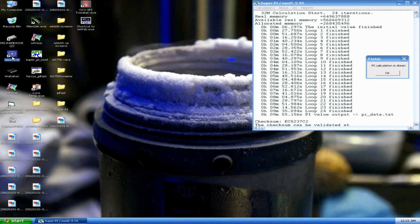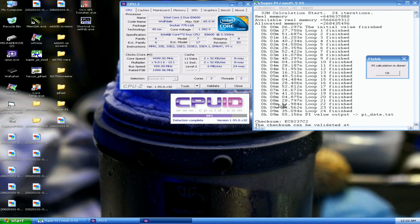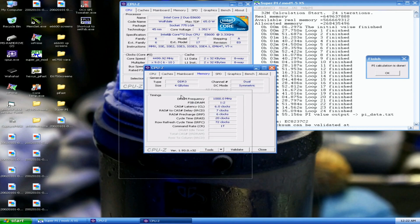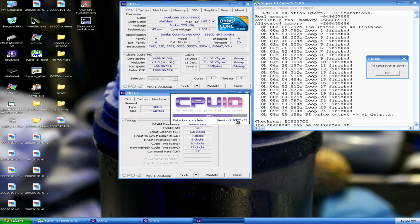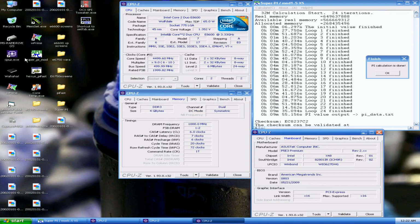Okay, so now I finally passed at 2000 megahertz, pretty much the same timing table, so 4.5 gigahertz on the CPU. In the first attempt I failed to post with 1.51 volts on the North Bridge, and it's very weird because any North Bridge voltage less than 1.5 volts usually posts and even boots happily, although below 1.4 volts I could not boot to the operating system anymore, but it can still post. Now I actually finally passed the SuperPi 32M test with a North Bridge voltage of 1.53 to 1.55. So it's quite weird. But I really don't like the 2000 megahertz profile because it's very tricky.